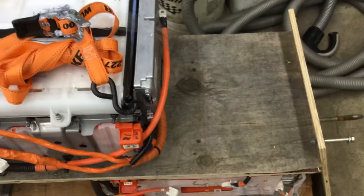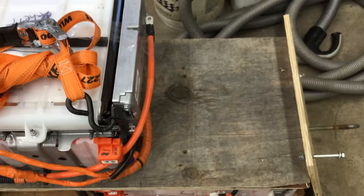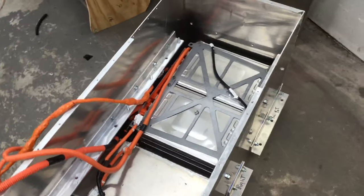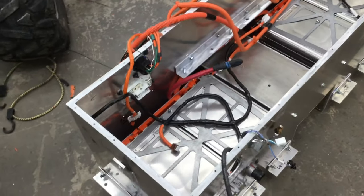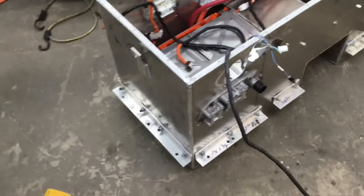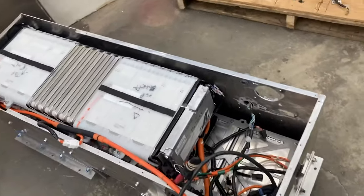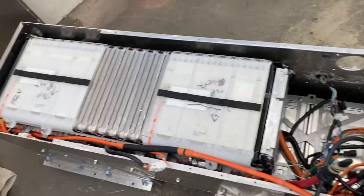The space over here is where I'm going to put my circuit breakers, switches, and relays. Here's the battery case — I've got the two lower battery modules in. You can see the supports for the upper battery case, and the different fittings for charging and leading out to the charger itself. The top battery is now in. The space to your right is where a plate will go with all the controls, which I'll be working on next after I bolt down the upper battery.